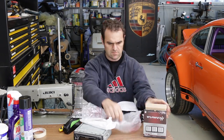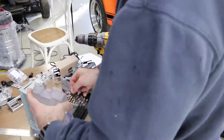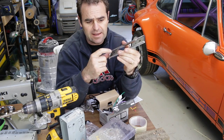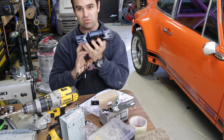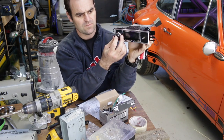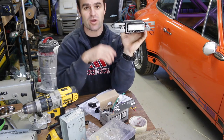So this new one has to be assembled. It comes with a faceplate and two little black pieces — there are lots of choices of colours and bits and pieces so you can mix and match to your preference. These side pieces are not pre-drilled, so I measured the centre and drilled them. You install this into the dash from the back, this goes over the top, then you've got your choice of knobs. I think it's a nice, suitable looking face for a stereo in my early 70s Porsche — quite a decent look. Now I need to work out how I'm going to mount it from the back.